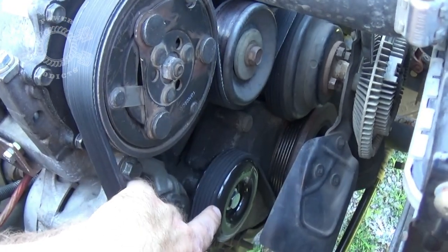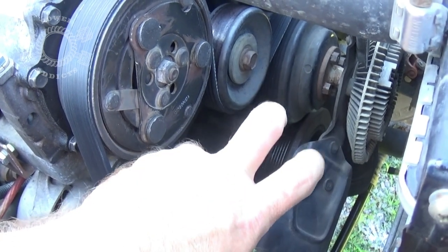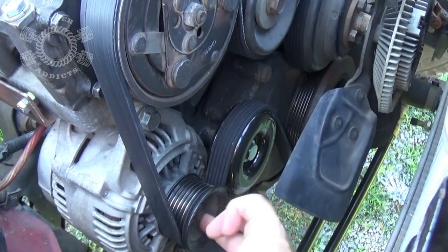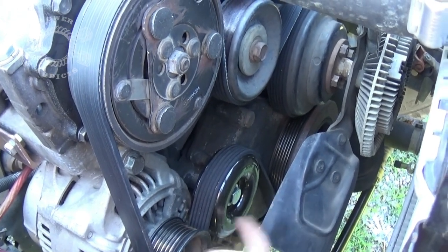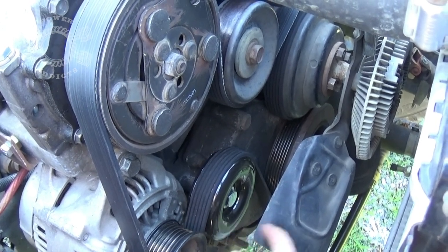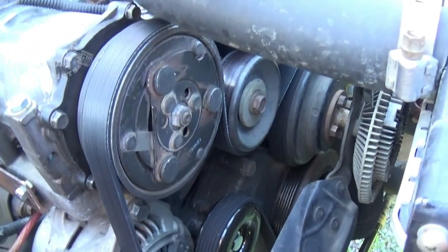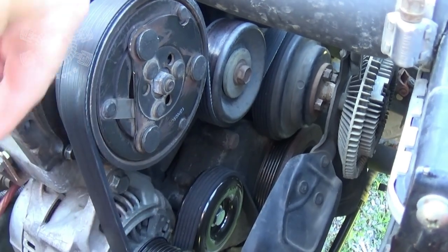So, my first impression was that I could just simply throw an AC belt on, meaning from a Jeep that came out of factory with AC. I thought it was going to come underneath this, come down there and off the alternator and down. I realized that belt was extremely too long because at the time I didn't realize I had to have this pulley. So after some research, I realized, hey, wait a minute, there's an extra pulley here for AC rigs. So that's how that came into play. But again, down in the description, I'll drop a link. You guys check out that video, which gives you all the details you need to do the belt conversion.